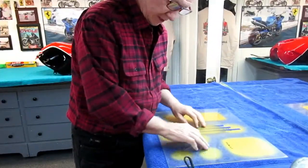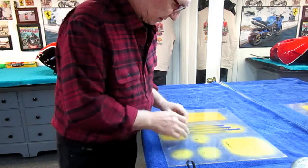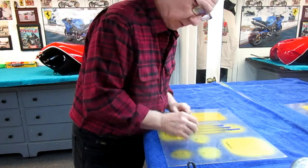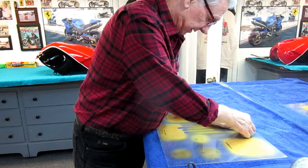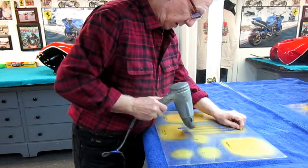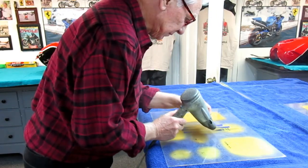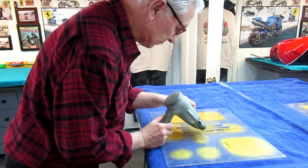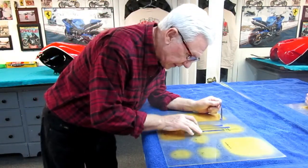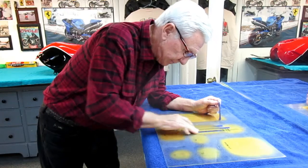Now this is the test piece of glass that we've been using for doing the test for this paint that we did. And because we're new to this paint, what we decided was early on in the day yesterday, I realized I would need 3 coats of gold, which I'm happy to do, but I put 3 coats on this glass also, and what I'm looking for now is the crispness of the paint edge. So as always pulling tape, I want to warm it up a little bit. Now the reason I'm looking is I can usually tell if paint has too much pigment, the edges can be a little rough. This looks pretty good, to be honest.